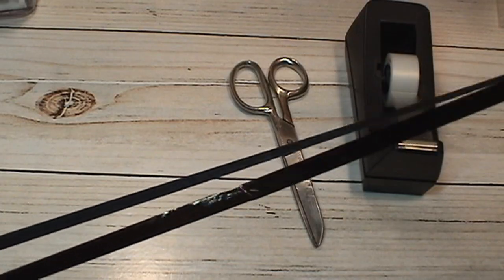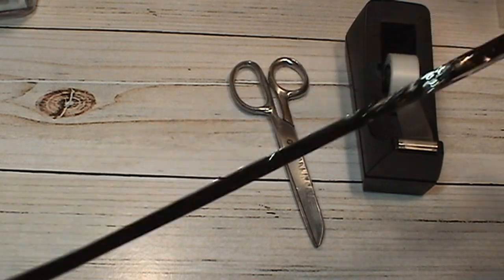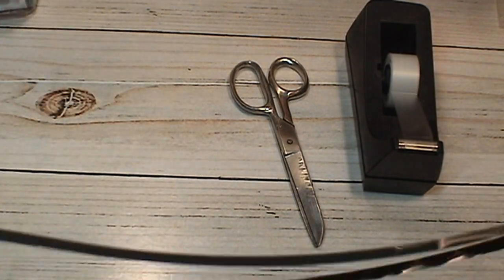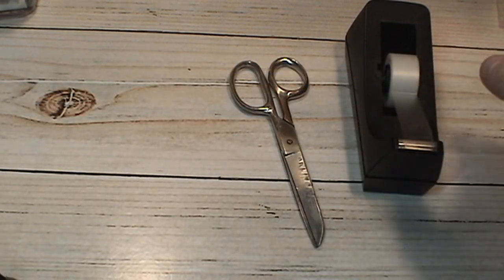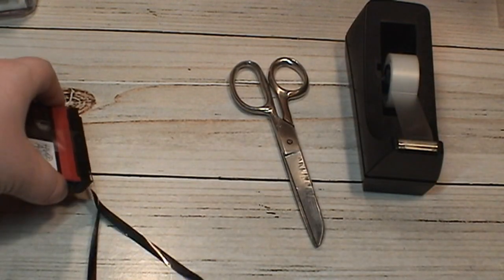that. Okay, yeah, that could definitely cause a problem. That tape is really chewed up. And on top of that, I'm also seeing, well, it's not going to translate onto video too well, but I'm seeing spots that look like lubricant. Has that already been spliced? That tape looks like it's already been spliced. Either way, it's got grease all over from the mechanism, so that can't stay.